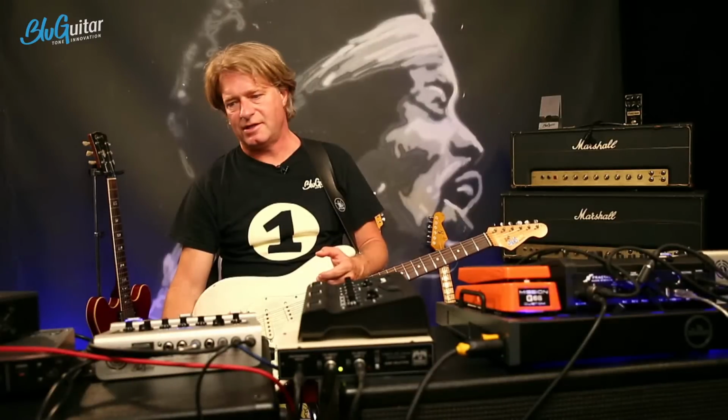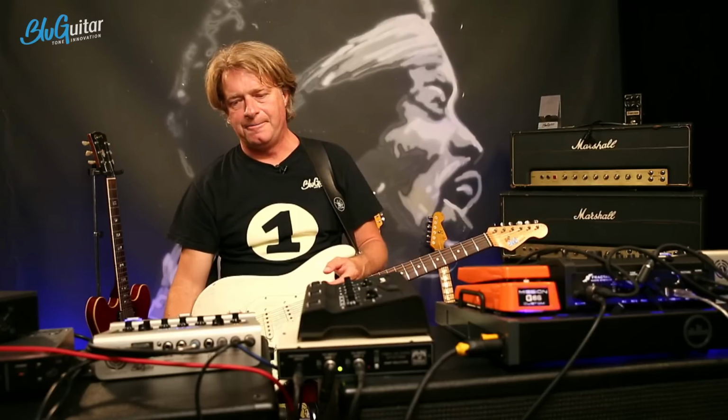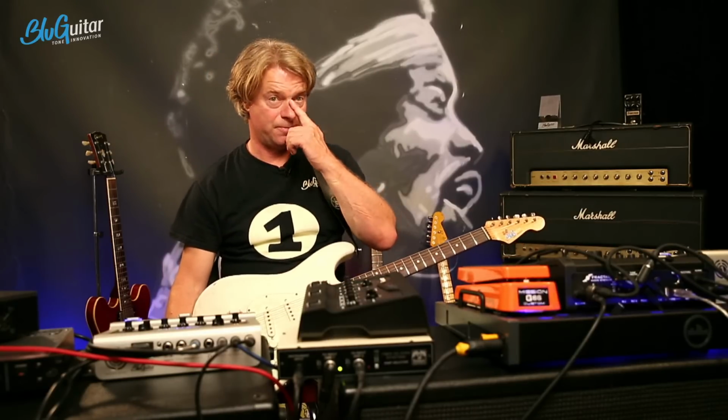Right, okay. So there is a fan built into the AMP1, and this is regulated. There are temperature sensors at a few parts, at the power amp stage and the power supply. It measures the temperature, and when it's at a certain value, it starts speeding up the fan. So there's nothing to worry about. The fan simply notices if the amp is on for a long time and maybe some heat is in the housing, so it speeds up to cool it down, and then it's cool for a long time again. But nothing to worry about. So all good.